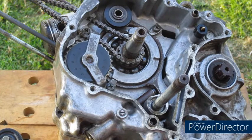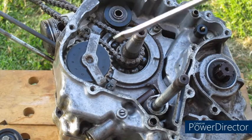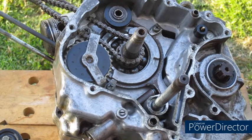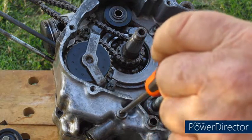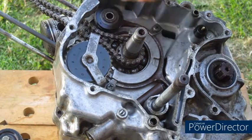On this old engine, I've removed the left-hand side cover and the flywheel, and we can see the components of the timing chain adjuster. Here is the sprocket, this is the end of the crankshaft, our timing chain, our oil pump drive, and our main cam chain adjuster. Here is the plunger that we spoke about before, the screw, and the second screw to adjust the compression on the springs. When we loosen this screw, as you can see, the plunger moves out with the spring behind it, rotates this cam adjuster, and presses against the chain.